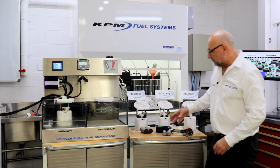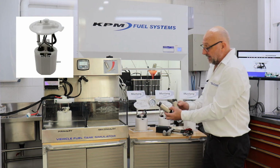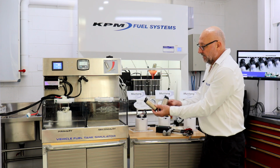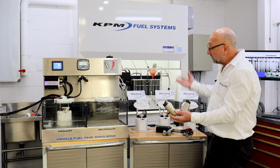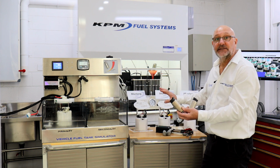And then we go to our big boy, which is the 1500 horsepower Mustang system, and that houses two of the Bosch Racing 540 pumps. So you've got the 800, the 1000, and the big boy, which is the 1500 horsepower. Now they're all a remove your standard module and a direct replacement. There is no mucking around, plug in, away you go.